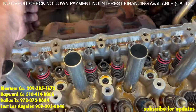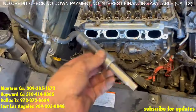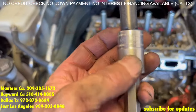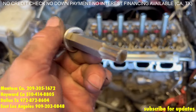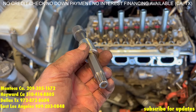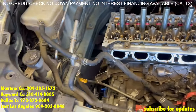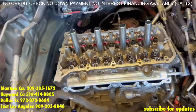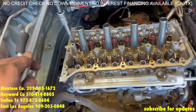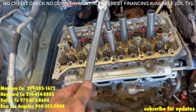Now that all the 12s and the 14 underneath are removed, you can push this back away from the cylinder head. To do the head bolts, we are going to be using an M10 — sorry, it is a Snap-on M10. It is basically just a regular triple square, so it has 12 points. If you don't have this, AutoZone has them — AutoZone's size is called an M12 and they have them on the shelf in half inch drive. You want to use a breaker bar to break them free — a nice stiff breaker bar. To take them off, you are going to remove the outside ones first, and then the next ones to the outside, and then the two center ones last.